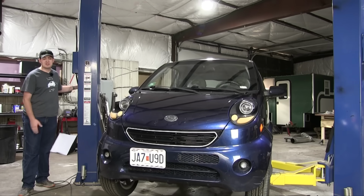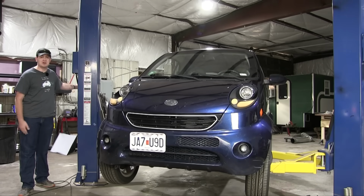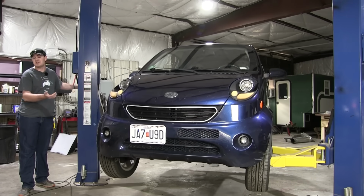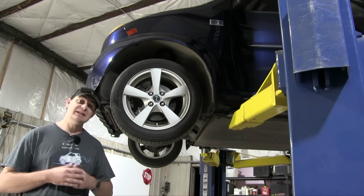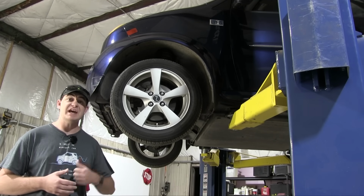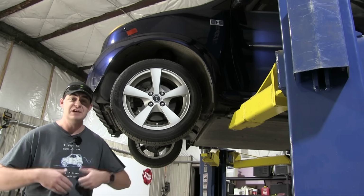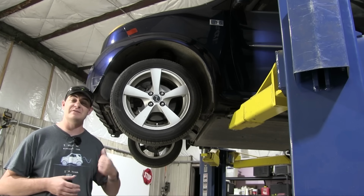It's an electric car, so your general maintenance on this thing is going to be drastically reduced over a combustion-powered car, because you don't have to do things like oil changes. And your brake pads will last a lot longer than they would on a combustion-powered car, because the Wheego, like most electric cars, has regenerative braking, which uses the motor as a generator when you let off the go pedal to reduce speed in the car and charge the batteries a little bit.